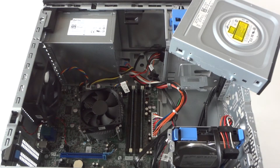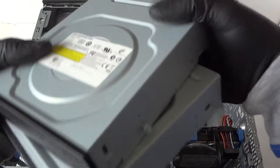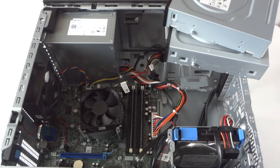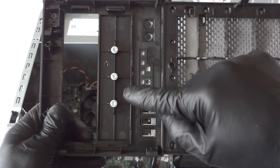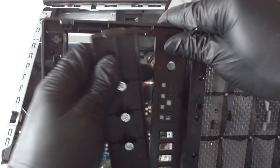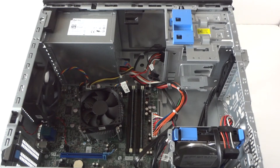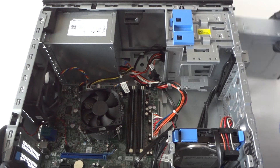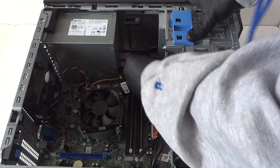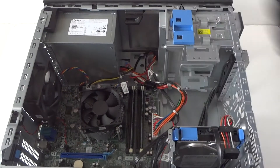Here's the new optical drive with screws already installed — two screws in the bottom and one on the right side. If you want to install a second optical drive, there are three more screws on the back of the front cover bezel you can use. Remove the plastic blank for the second bay if needed. Slide the optical drive in, reconnect the SATA power cable, and reinstall the front cover bezel.